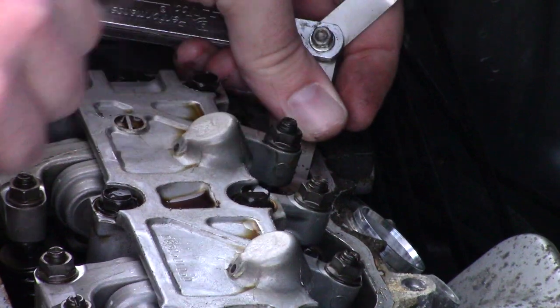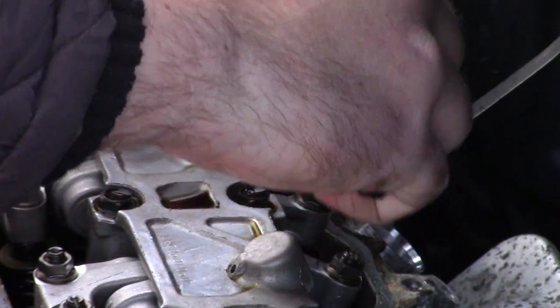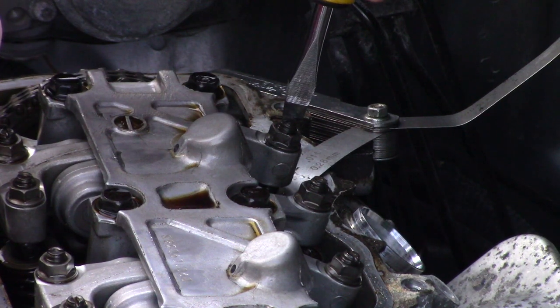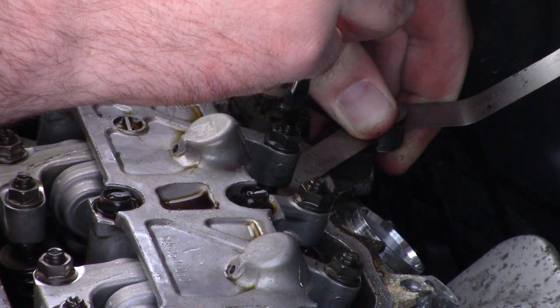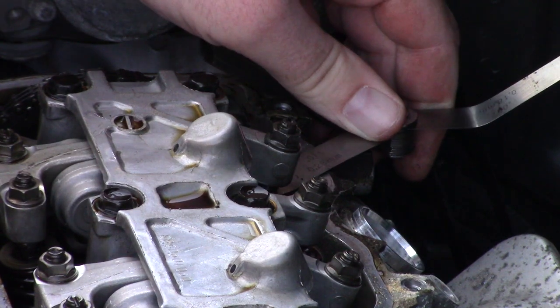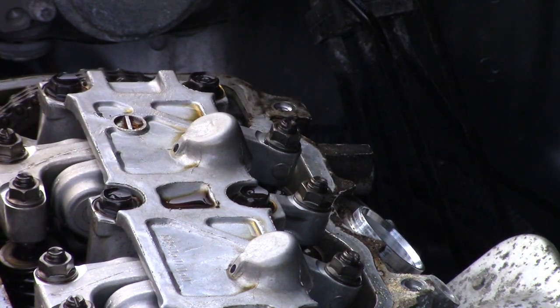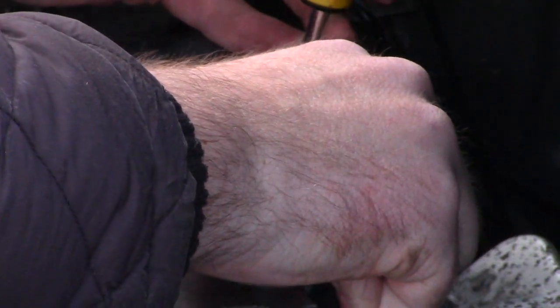I can move this one with the feeler gauge in it, so we're going to tighten that one. Don't be worried if you need to use a tool to loosen the adjusting screw. Now with the feeler gauge installed, we want to tighten the adjusting screw ever so slightly — until we can still feel a little bit of drag. That's too much, so we'll back it off a little bit until we get just a little bit of drag. That took almost about a quarter turn to get tight. Now we're going to remove the feeler gauge, put the adjusting screwdriver back on so it doesn't move while we tighten the locking nut, and then tighten the whole assembly.